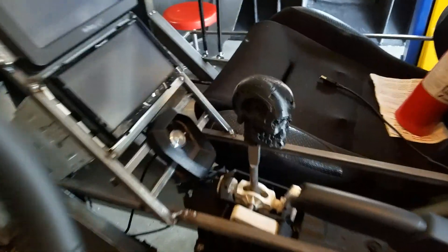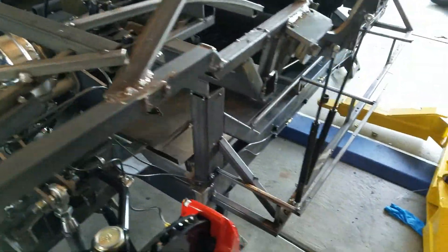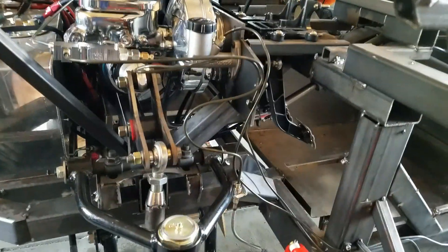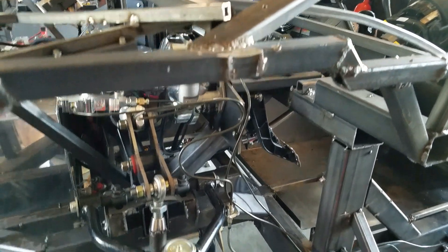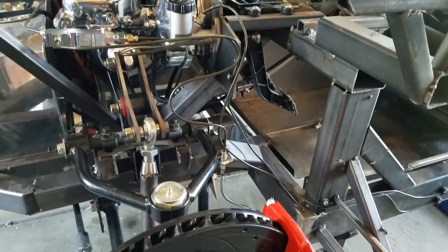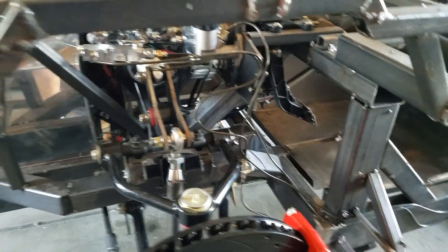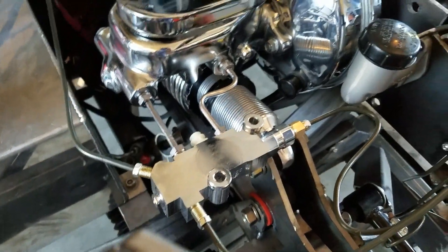One of the first things we did was set up a push-button start. What that usually means is the brakes need to work — you push on the brake and then it allows you to engage the starter which fires the engine. We had to get the brakes working. We plumbed the brake system and got it all in with basically factory flares, so I didn't have to do any flaring. There's a little bit of monkey business here which will be taken care of later by making our own length flared tubes. I do have a flaring tool, so we'll be able to do inverted flares — double inverted flares. We've got our master cylinder, vacuum booster, and a proportioning valve, so there are a lot of connections here.